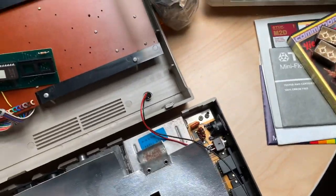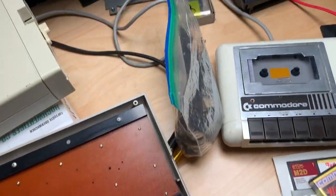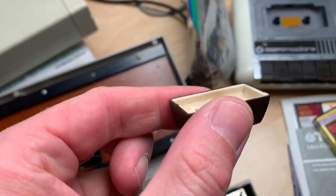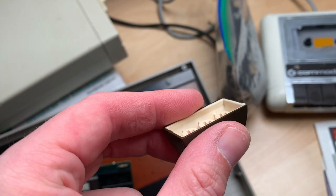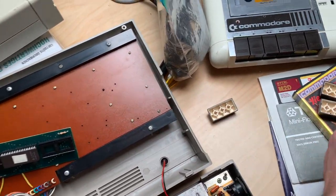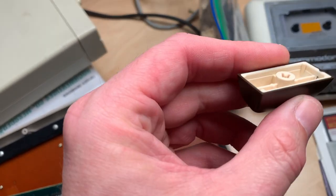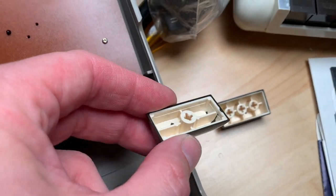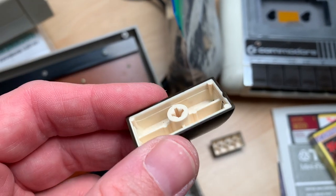While I was cleaning the keys, I thought why not bring out some other keys? I have a bag of C64 spare keys. These look like this, and as you can see, the key stems inside are a little recessed. This is the return key, by the way. If we look at the return key from this keyboard, you can see first of all there's only one stem instead of three, and this stem is not recessed. So this pretty much explains why there's so little travel in the key.